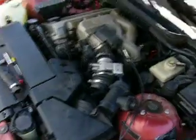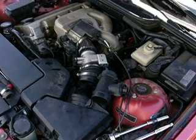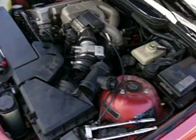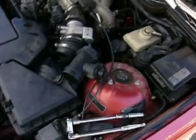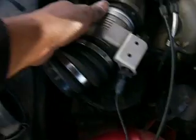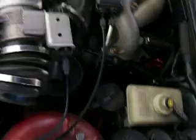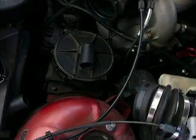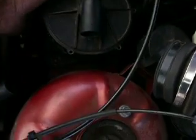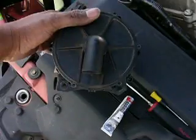After getting a code through the OBD2 system for smog pump, that means that the pump is either frozen or it's leaking. In this case, it was leaking, so we go in and take your airflow meter out and disconnect your throttle body and boots and disconnect all your hoses and unscrew the 2 13 millimeters, and there's a wire harness underneath the pump that you have to disconnect, and you have to disconnect all your hoses, and we're just going to shoot it right here.